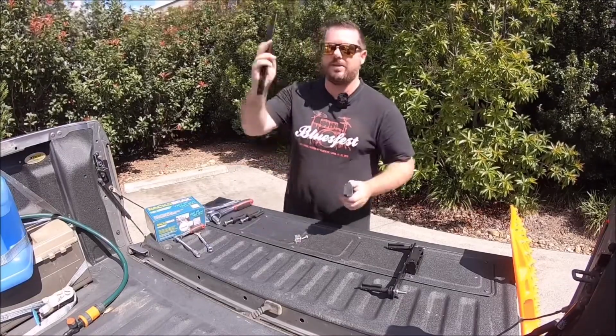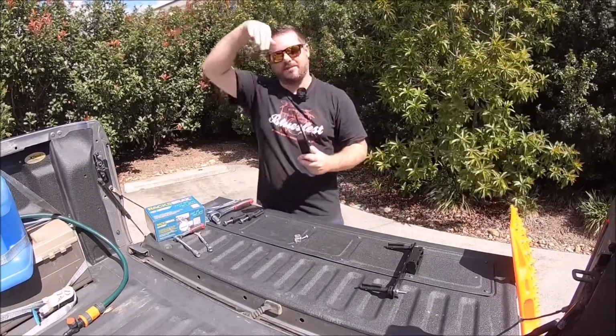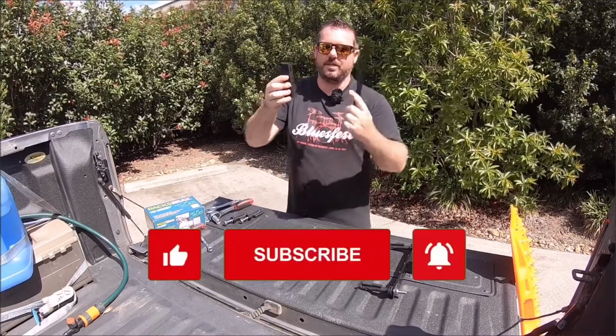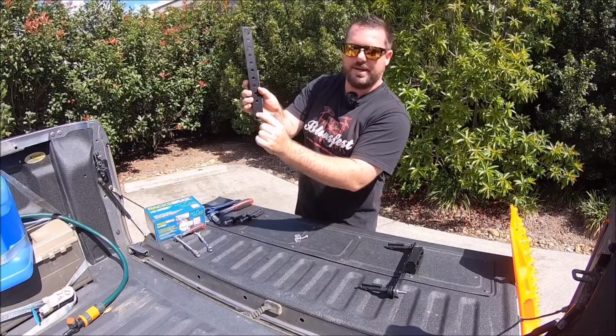Now I need as much height as I can get so I can still open my passenger side door with the maxtrax still on it, because obviously I'm having my RacksBrax facing down so I can get into the garage. So that's going to be sitting like that. I need it as low as possible. I need the maxtrax as high as possible. So the maxtrax bolt will go through that very bottom one there, the large one.